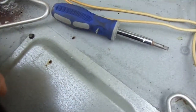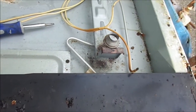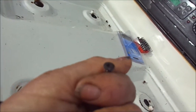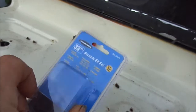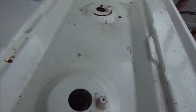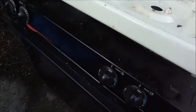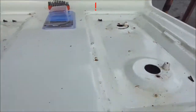I just wanted to check this one to make sure there was no further adjustment needed for propane. Sometimes they'll have a valve adjustment, but I don't see any here so I think we're good. These are star torx screws — you can get a star security torx bit set for them at most hardware stores. These screws have to be taken off the top and disconnected from the inner burner in order to take the top off, or you'll mangle the feed tubes for the jets.